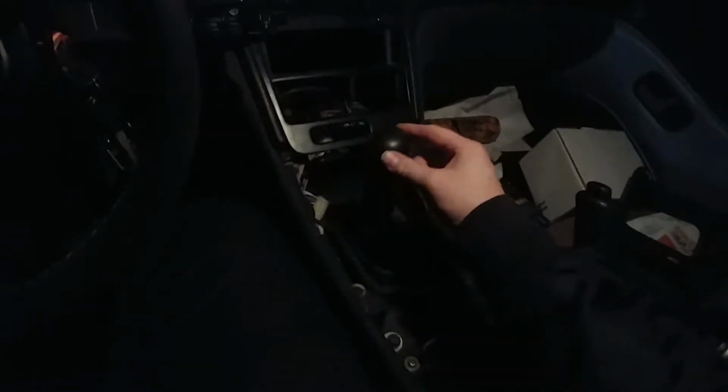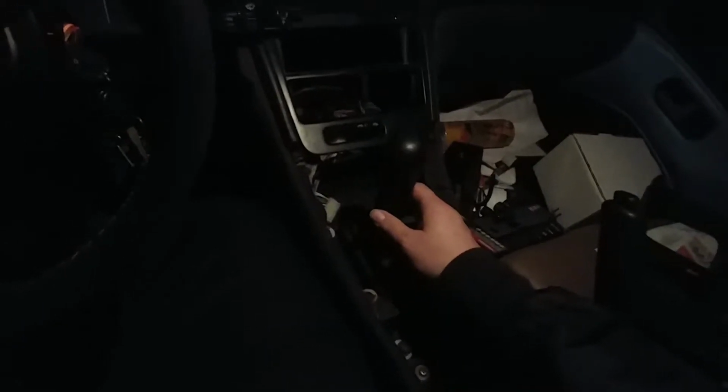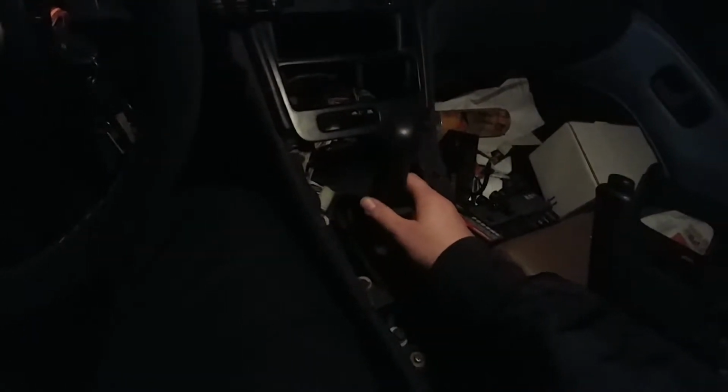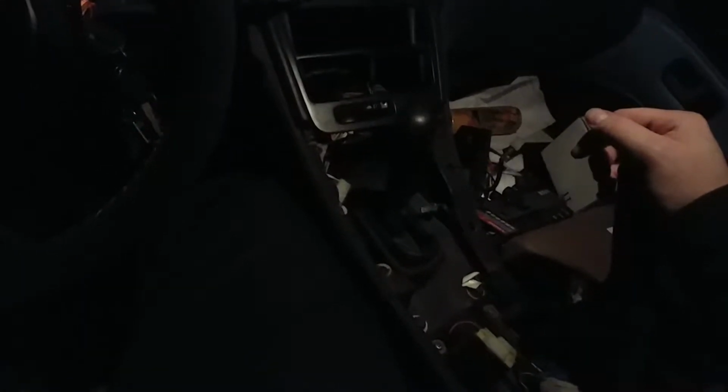Still kind of need a new shifter. This one is, well, the physical ball joint here is worn out apparently, and I've got a lot of play that I should not have, and it feels similar to when a bushing is really sloppy or bad, and I have bronze bushing, so it's not the bushing. Also checked the input fork thinking, okay, well maybe it's the linkage. Nope, it's not the linkage. So well, that's eBay shifter for you. They're not meant to last, or expected to.